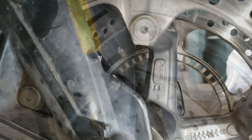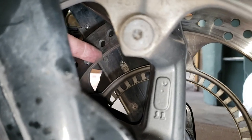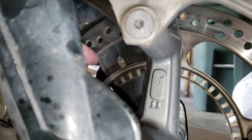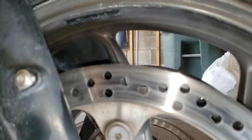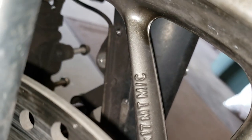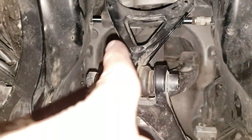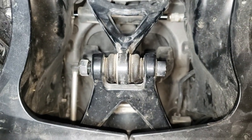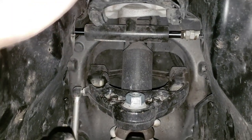Hopefully that will be the last step. The third screw is behind the bottom edge of the rotor — I simply can't get to it with the tools I have because it is halfway below the rotor. I'm going to have to take the rotor bolts off and slide that out of the way so I can get to that last bolt. With the brake disc and the ABS ring disconnected, I can now get to that last bolt. To get to this top nut, there's just no way to do it without taking this linkage apart, so I've got the bolts loose. Now with this link disconnected, I can tie this up out of the way, and now I have great access to the top nut.